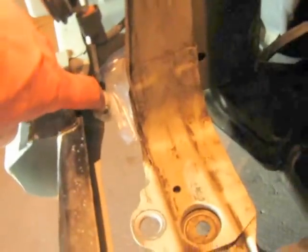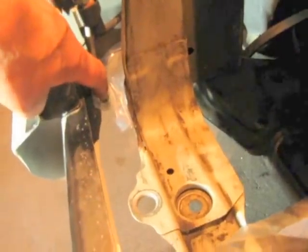Your high pressure's on this side down below, and it too is a 10 millimeter, and I got to it through the side right there. You can kind of see the back side of it right there, and took that little guy out, took the other one off, and lifted the condenser right out, and here she is.